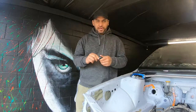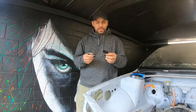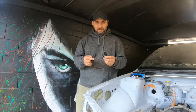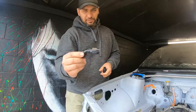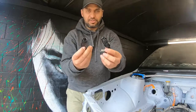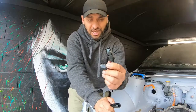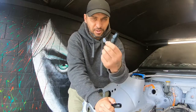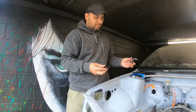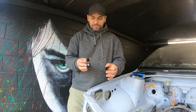Last night I spent a few hours underneath the car, getting frustrated as hell, and I learnt a little thing about AN fittings. I've been using these for quite a while but never really installed them myself. I'm going to explain the difference between these two particular fittings I've got here - I've got a 45-degree bend and a 120-degree bend, both dash-8. This one here is your normal series 100 braided hose fitting. But when you start using Teflon PTFE line, it has a special PTFE fitting. The first thing you'll notice is it's got a flat edge on the lid, and inside that's where your collar sits, with a shorter thread with a flat edge so the collar can go hard against it. My pump was mounted under the car where I'm standing, and because I've moved it, the angles changed. I tried to swap the fittings over, thinking because they're both dash-8 they'd just hook up - but no, that's not the case.